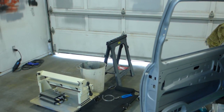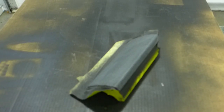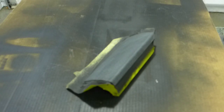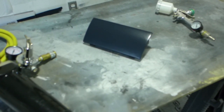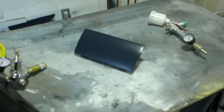I'm back in the painting business a little bit. This is the ashtray that I'm putting the electronics into. I just finished putting the texture coating on it — now I'm going to hit it with midnight blue, then bend up the sheet metal for the panel and punch holes and nibble away at it until I can get all the switches and rotary controls in there. It'll take about a week to get it all done because I also need to get labels made for the switches. It's painted up and looks pretty good — just a tiny bit of surface imperfection I'll carefully sand out, and then it's ready to mount the electronics.